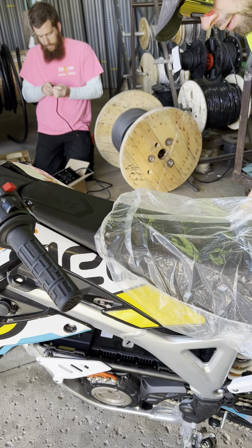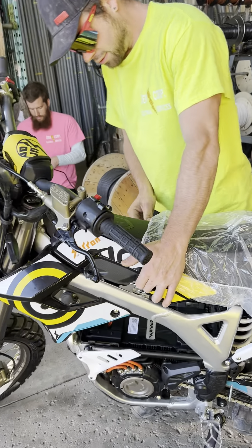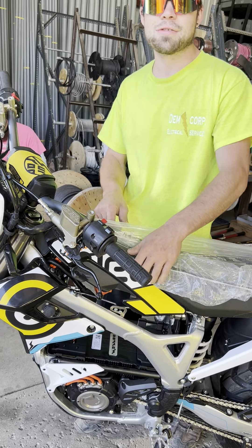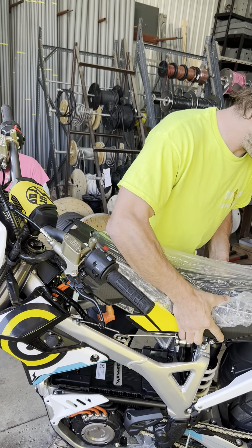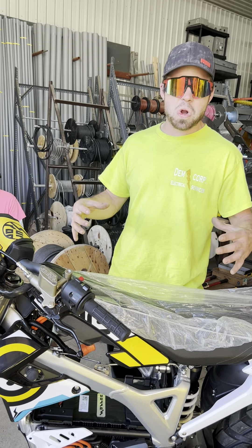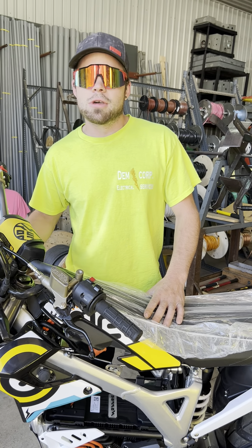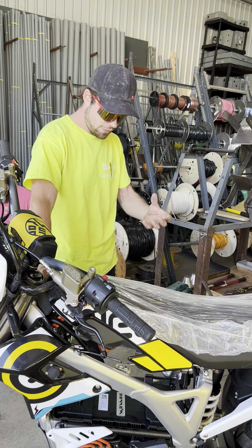We haven't heard back from Venom yet for the battery or motor for your quad. Well, trying to put it through proper testing I decided to take it through some really deep snow — it got in through the motor and it looks like it rusted out all the brushes inside. As soon as you turn the key on, put it in forward and grab the throttle, it just makes a grinding noise and doesn't go anywhere. Did some testing, made sure the motor was getting the proper signal — all was well there — so I came to the conclusion it needs a new motor.